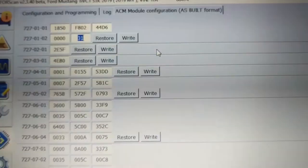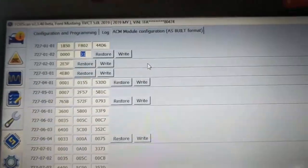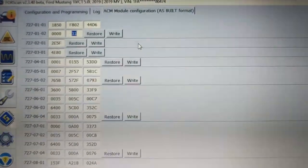Once you change that value, hit Write, and reboot the car — switch it on and off — it is amazing the amount of difference you get in the sound system. Evidently from the factory, Ford has already programmed this car with factory equalizers and settings in place to protect the cheap speakers they put in here. If you watch my speaker install video you'll understand just how cheap and paper-thin the factory speakers are. They put that fail-safe in place to protect them from everybody turning it up wide open and blowing the speakers.